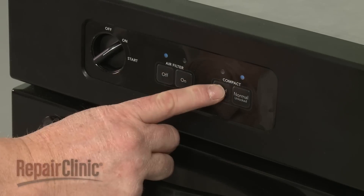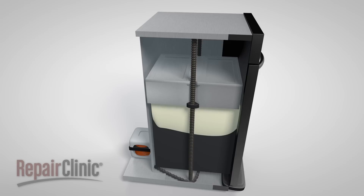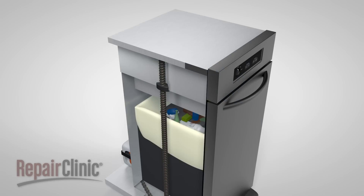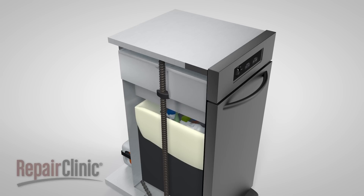Be aware that many models offer a solid or hard pack option, which keeps the ram in the down position once the trash has been compressed. Some models also have a drawer tilt switch, which will close and raise the ram if the drawer is out of alignment, preventing further damage to the compactor.